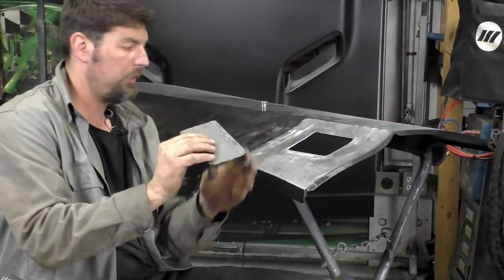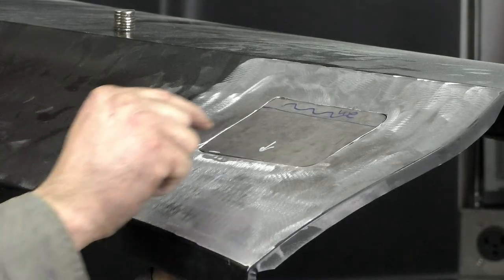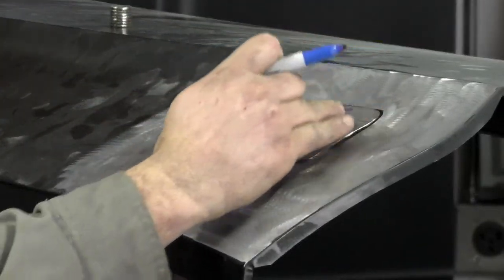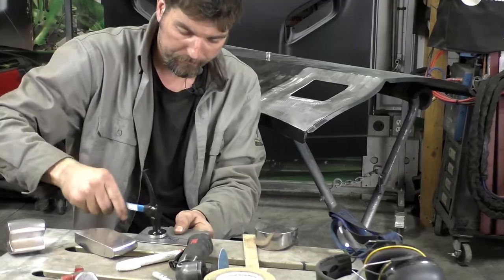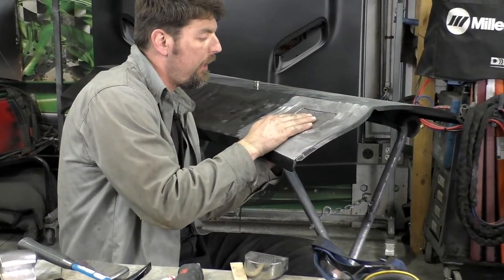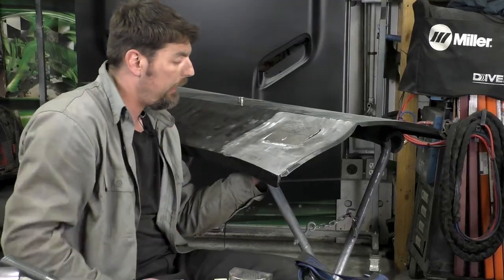There we got just a bare little bit of a profile. So that looks good but we're actually going to have to come back — I see we're going to have to flatten this area out right there. It curves and flattens out this area and then curves back up, so this is the transition period right here. We're just doing the rough body work to get it close because we want this to match the door as best we can. That looks pretty good, so at this point we'll go ahead, clean this up with the 80-grit, get it in place, and get our welder set up.